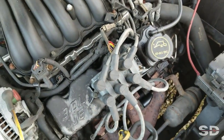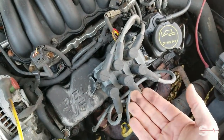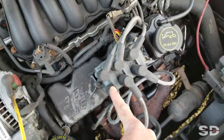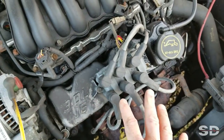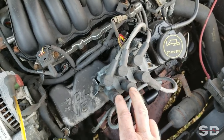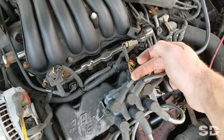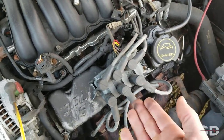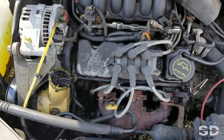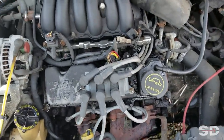Open plug wires will cause high KV and it will cause the spark to literally burrow in through the bottom of the coil, and that's why half of it doesn't fire. The fact that we have spark on all three coils — granted half of the coil on these two — tells us our controls are good, from the engine computer to the coil assembly. This absolutely 100% needs a coil pack, and we need to make sure to check these plug wires out real good to make sure we don't have any open plug wires or faulty plugs that caused this condition.